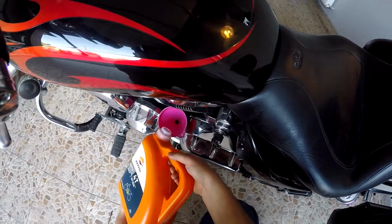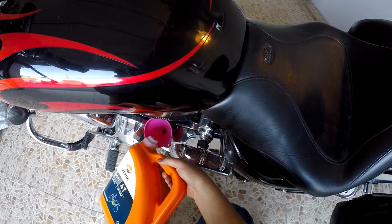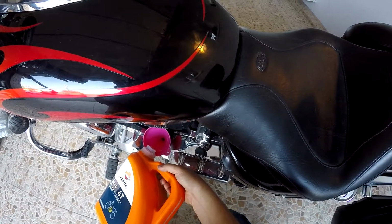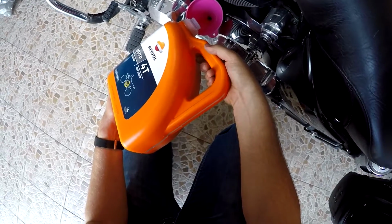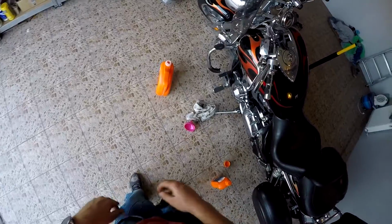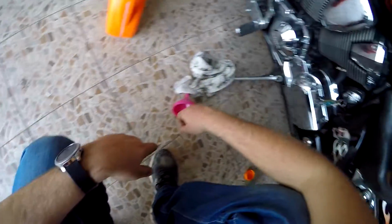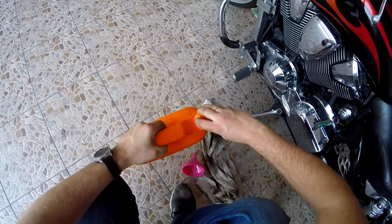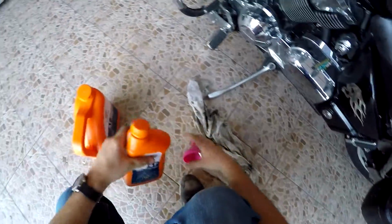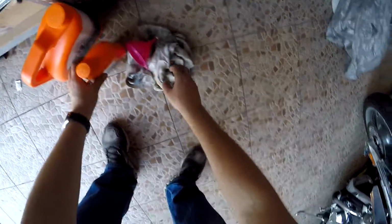Okay, let's go little by little. Well, for sure I can be sure that it requires more than 3 liters, so initially I put 3 liters inside, little by little, and then I'll check. It will take some time, guys, so I'll skip it. So guys, I put inside around 3 liters, and what I'm gonna do is I'm gonna put this bike there again from my garage, and I'm gonna start it with the amount of oil we have there on idle power, and after that I'll just shut it down and wait for maybe 5 minutes or so to check the oil with the dipstick.